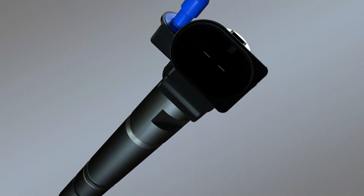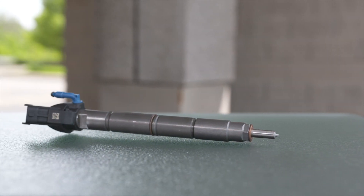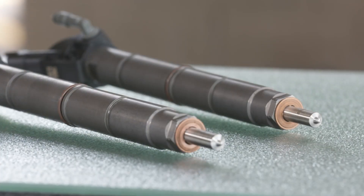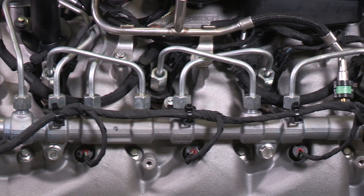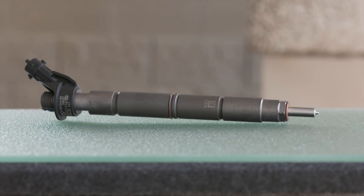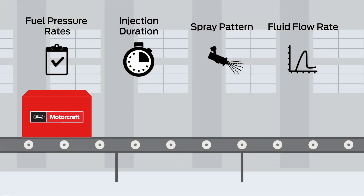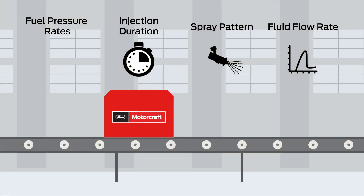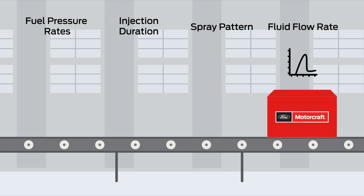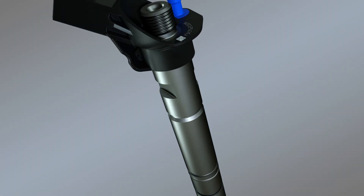The few non-wear components used in construction are thoroughly inspected and must pass stringent standards for reman parts usage. Not only are these new Motorcraft fuel injectors remanufactured using the same equipment as brand new 6.7-liter fuel injectors, but the reman injector is also tested against the exact same OEM specifications as brand new injectors. This includes tests for specified fuel pressure rates, time tests for injection duration, even spray pattern, and controlled temperature fluid flow rate testing.